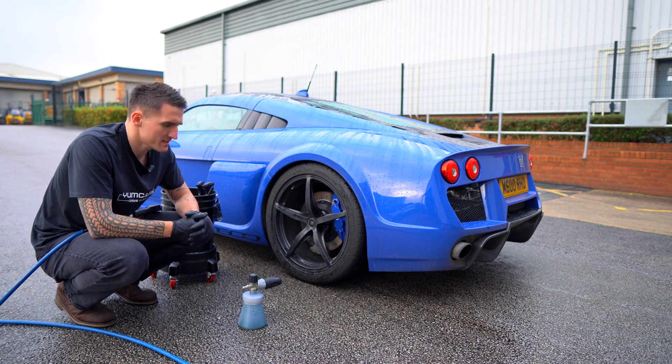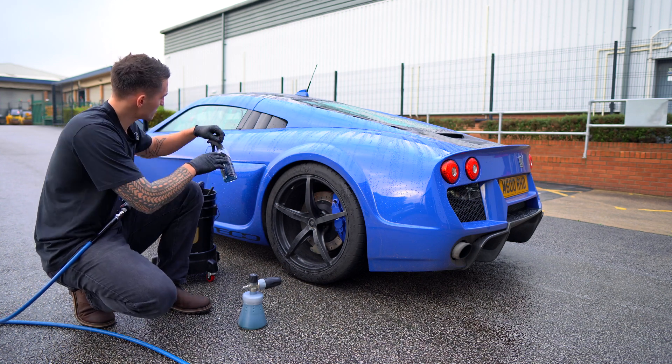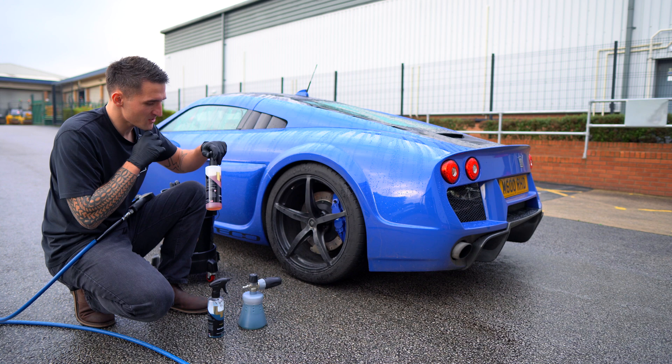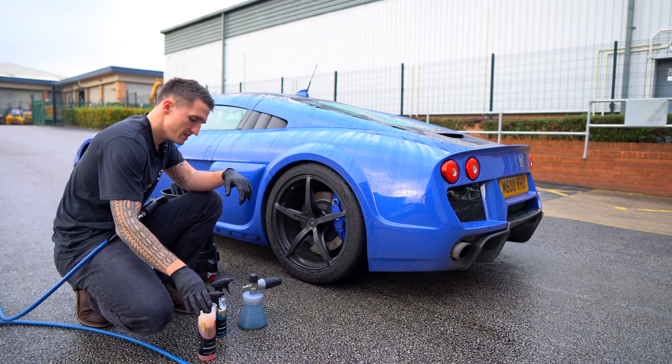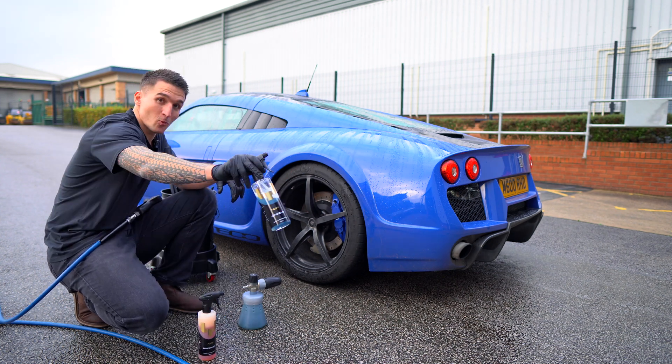When I keep saying a three-tier cleaning system, what exactly does that mean? You could technically call it a two-step because the undress, irrespective of how you do it, is going to have to be done anyway. Undress goes on your tires, wheels goes on your wheels. Because wheels is a thinner consistency product, it has the tendency — especially in warmer temperatures — to actually dry out prematurely. You shouldn't be cleaning your wheel when it's hot to the touch, but that's what happens with all thin consistency liquids.